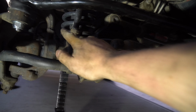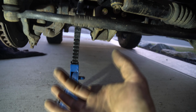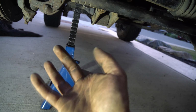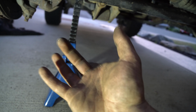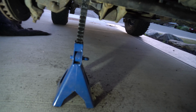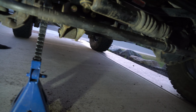So had Mika check, and both those back bolts back there are now at 40, after you get that U-bolt, not U-joint, tightened. Like I said, you balance it equally, and then I ended up, after I had about the same amount of threads, crank this side till it was at 40, crank that side till it was at 40, and they both clicked around the same. We're all good. Next thing to do is let's get this steering stabilizer in, so that way we can get the wheel back on so we can get our track bar aligned.